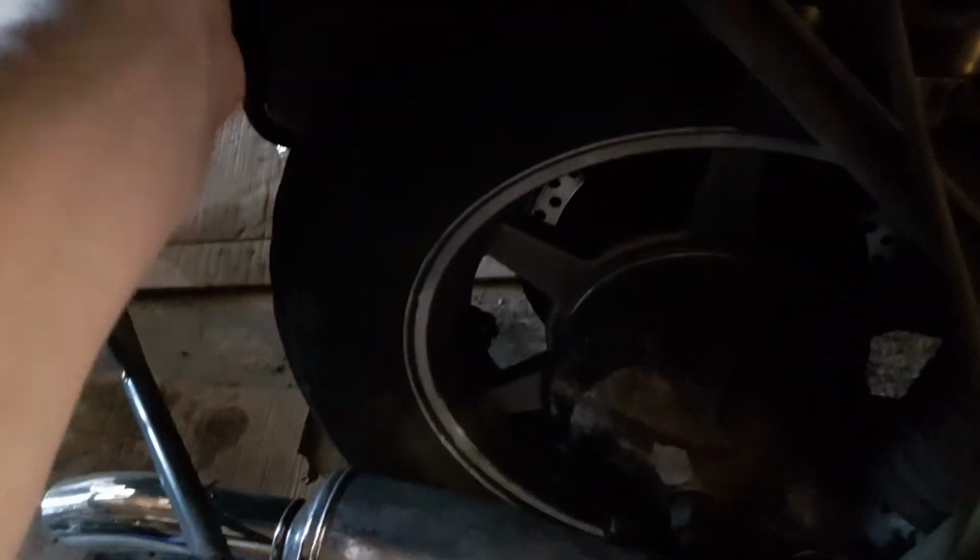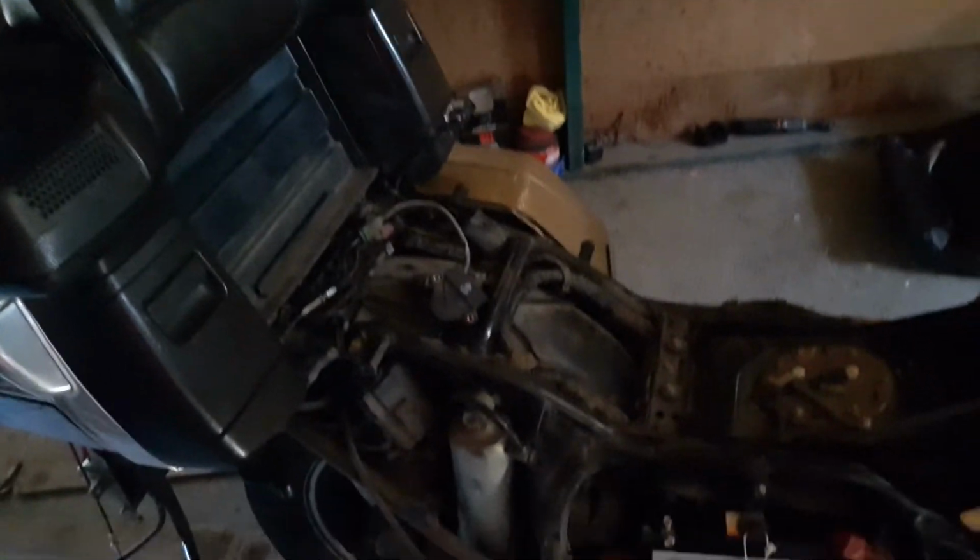So if you have any issues with the bike cutting out, then you can reset the key and it starts fine, and then you shake it again and it cuts out, and that's what it is on a 91. Well, this one's 91. Anyway, on the 1500 Goldwing.